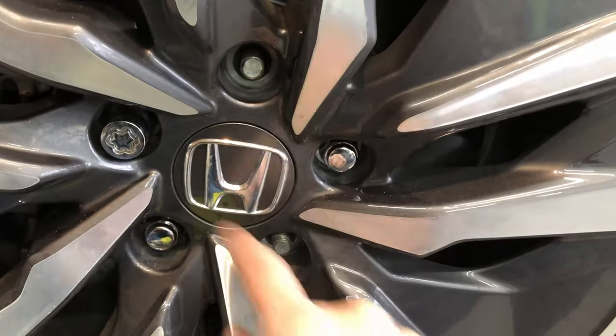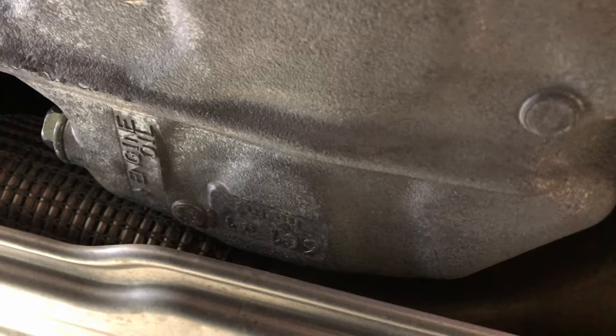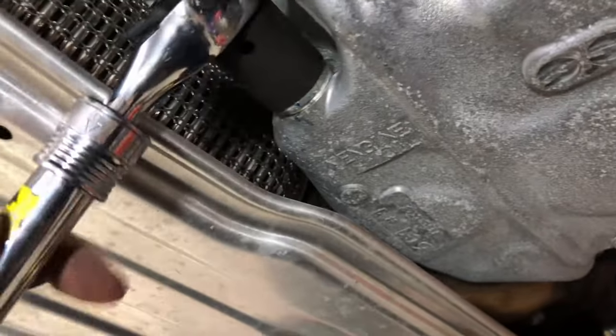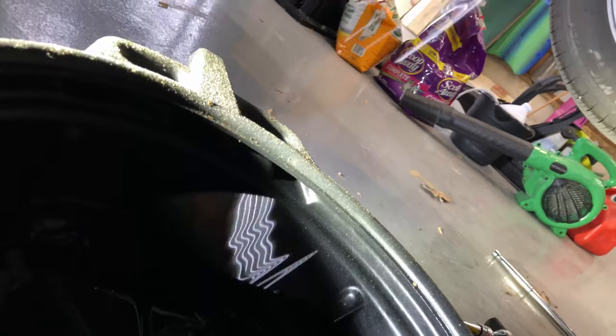After the tire rotation is completed, I'm then going to lift the car all the way up to the first locking position. Here is the location of the oil drain bolt and the filter. It's easy to find because on this car there's no under tray and a million clips to remove — it's right there and easy to spot. The oil drain bolt is 17mm and is really easy to loosen. In my case, a socket wrench was able to get it out — I didn't have to use a breaker bar like on some other cars I've done.